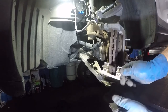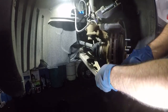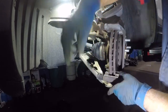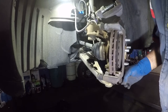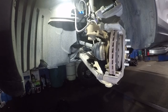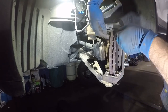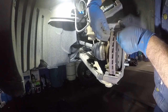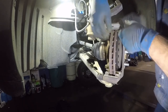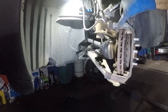After that, take your hardware kit and simply stick it in just like so. Make sure it does not hit the disc — if it hits the disc you're gonna have a noise — so make sure you have a little bit of clearance on the disc. Same thing for the top one: stick it in and it goes right in there.